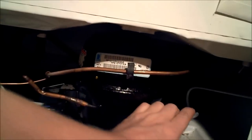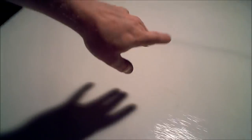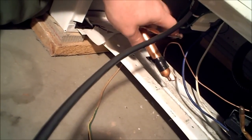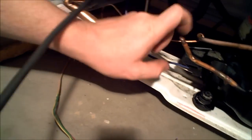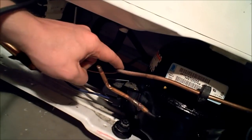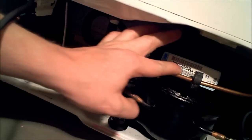So the compressor: this would be your low side, this is your high side. It actually compresses the liquid, forces it up here, through the entire sides, through your accumulator dryer, through this little capillary tube, up, inside, back and forth through the lines inside your freezer, providing the cooling, and then back into the compressor.